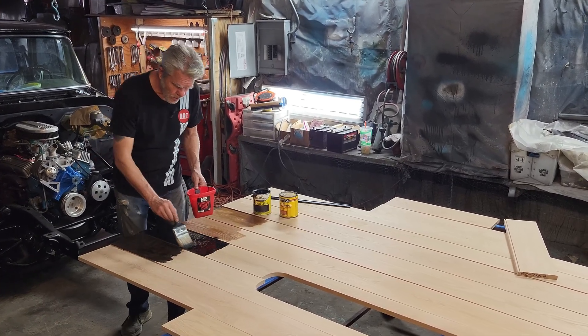I think we're going to go with the black on this because the oak is just a little bit too light — a little too fluffy. I'll be shooting a clear coat on this. I don't like to use the spar varnish stuff or the marine finish — they just turn yellow and crack too soon. So I'll actually be shooting this with the same automotive clear coat that I used on the '62. I'll be doing another video on that soon, so make sure you stay tuned for that.